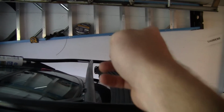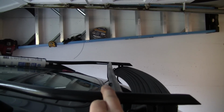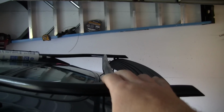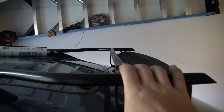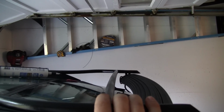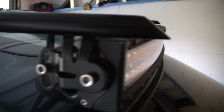That middle pipe, there's a little bit of a bend to it. I made that middle pipe too short by accident. And this conduit's $15 a stick. If I did everything right, I would have had enough out of one stick of conduit to do the entire rack. But I screwed it up the first time and made it like 3/8 too short. So I had to go out and buy a new stick, and I didn't want to make it too long and have it pushing out. I'd rather have it kind of pulling everything in, so I made it just a hair too short. You see it's got a little bit of a bow to it, but no big deal. Everything bolted up, and these brackets turned out pretty good.